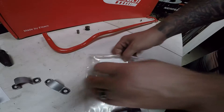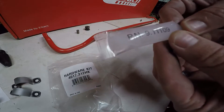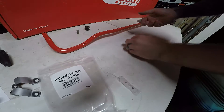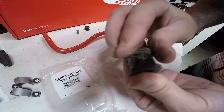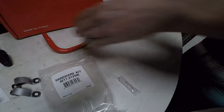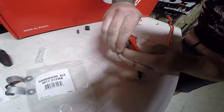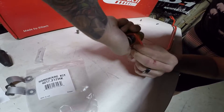What I like to do is take out the little pre-lube packet in the package — it's a polyurethane grease. Take a little bit of that on your fingers and just kind of rub it on this bushing, because this bushing hasn't had a lot of attention in years. So if you're going to be using the stock one, I suggest lube it up. Pretty much just got to put it in now. Start by kind of twisting it in there at an angle — if you press at an angle it should start to squeeze in there, and eventually you should be able to pop it right in.